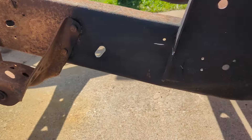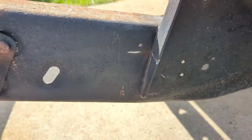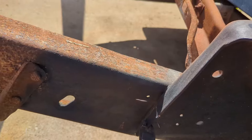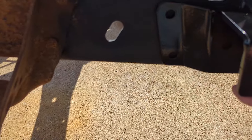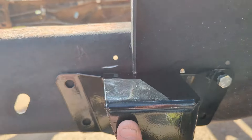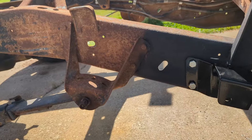We have to move these spring perches forward. I got lowering spring hangers, and this one we're going to have to cut out, which I already did — took my angle grinder to it. There's a bolt hole under this front bed mount; we'll utilize that one, square it up and drill some holes. After we put a bolt through that hole, I'll put this where we need it, square the other side off of this side. It's probably about 18 inches forward.